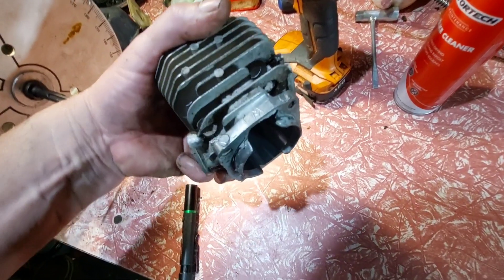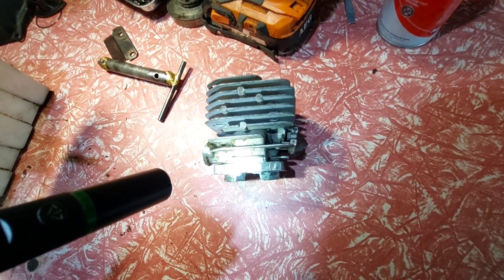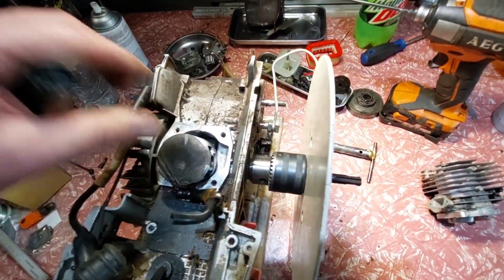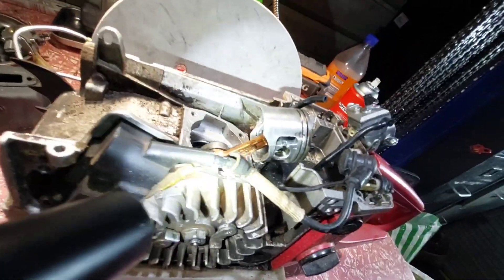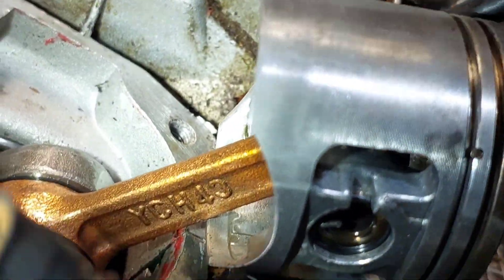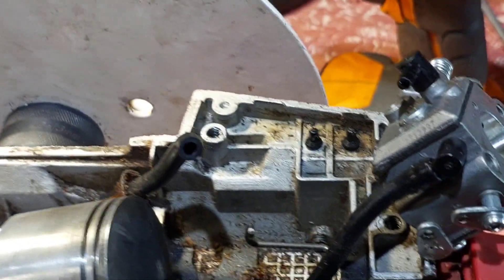For what this is, I'm surprised. I finally think I found a brand name - apparently there's a wide M at the top, so if I ever see this again I'll buy that. You've got 45 at the top there - I'll wipe that off. It's 45 just there, that's the size of the motor. The width of that piston is 43mm, and you'll probably see on the actual connecting rod - 43 on the connecting rod. I'll show you a mark on that. These little motors are pretty good when it comes to stuff like that. 43 on the actual Conrad or connecting rod. As you can see - pretty easy to get the right parts if you know what you're looking for. Yeah, 43. That's what this is - 43mm equals 45cc or 46cc, depends on what the cylinder says on the stickers.